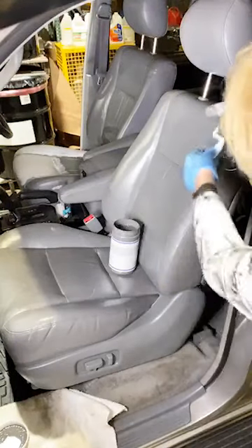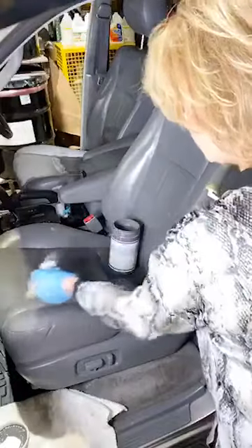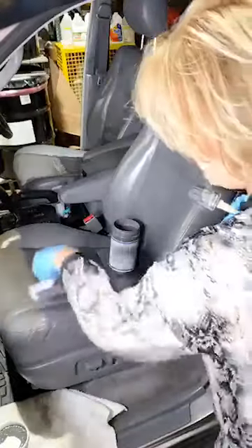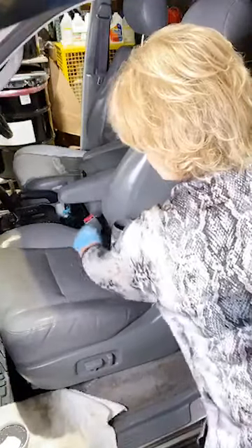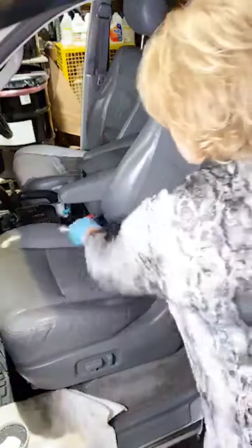One quart will pretty much do any vehicle and you'll get fabulous results using this little tiny sponge or the true applicator — whichever you have on hand. This roller goes over big flat surfaces so quick and easy. There are some wear marks here on the front of the seat. I'm just putting on a nice coat of paint and rolling back through it — using the dry roller to roll through gives me a non-brushed-on effect. I already cleaned the seat yesterday using the prep product, our deglosser.